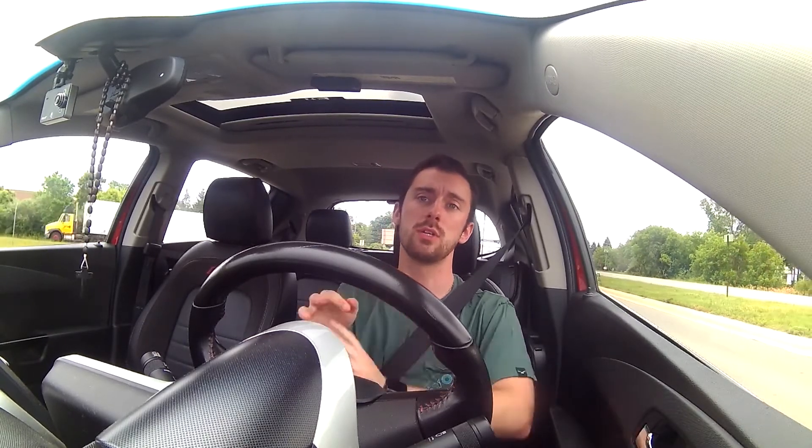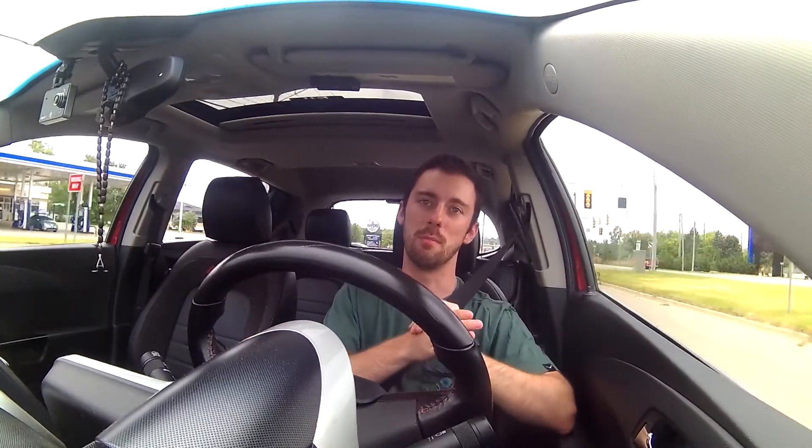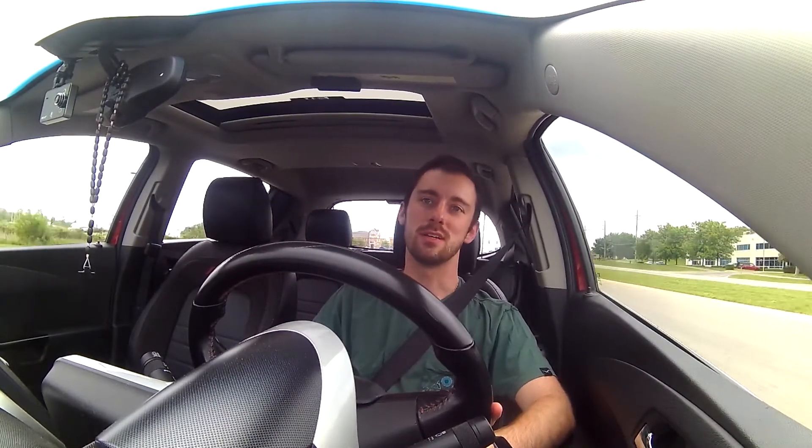I will say, if you're actually installing this on a Sonic, you are going to have to trim your headlight housing if you have the RS, and possibly if you have the LTZ as well, because the charge pipe is in the way. But once we trimmed that, everything fit back up nicely and it looks pretty good. It has metal charge piping now with the ZZP logo, so it definitely looks better too. Shout-out to Brandon for helping me again on the project — it goes a long way. His camper van build might be featured on the channel. It's painted baby blue.